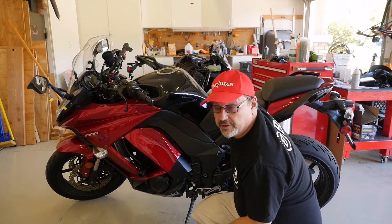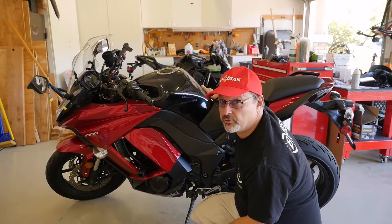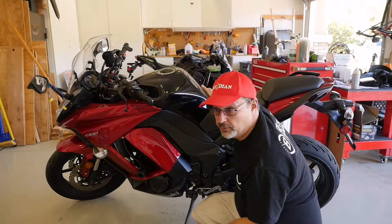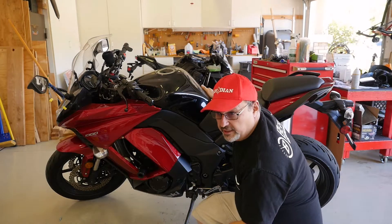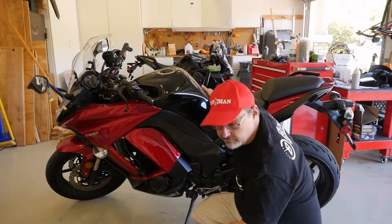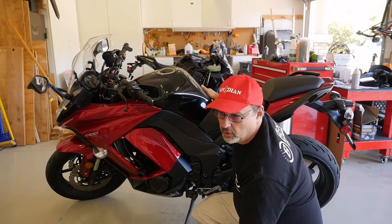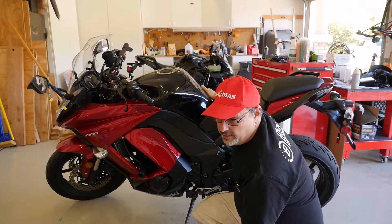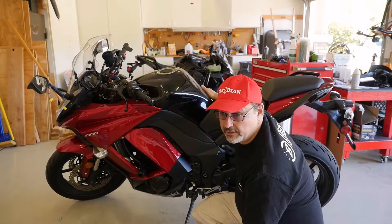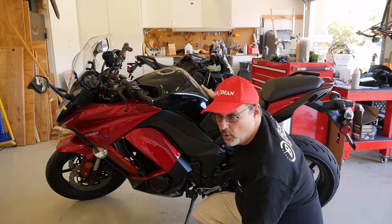The first thing I'll do is get the bike up on the lift. I have a center stand by ABBA — I did a review on that, and I'm torn as to whether or not I like it. It's a lot more work than a normal rear stand like a Pit Bull or rear spool stands. I can't use those because the mount for the rear spool on one side snapped off — the spool is just about an eighth to a quarter inch too long, and under high compression on the rear shock the exhaust system hit it and snapped it right off. So unless I feel like welding it back on, I'm without rear spool, and I'm going to try the ABBA stand.